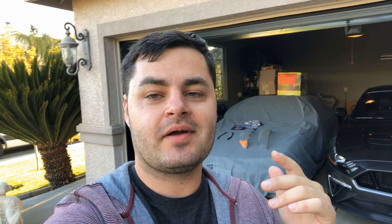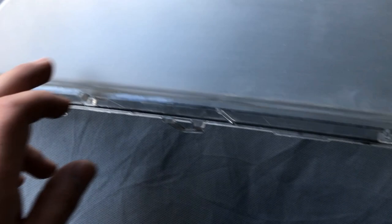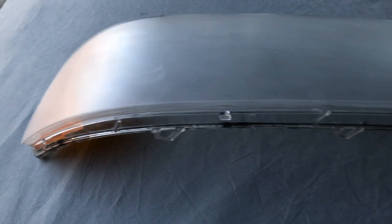Finally done — about an hour and 30 minutes later. Lenses are on my car. Let me show them to you. The process was: started off with 600 grit, then I thought I should go down a bit and went to 400. I would say the process for 400 on this type of job is not worth it — just stick to 600, keep scuffing. Your hands may get tired, but in the long run it will be all worth it. Then the final stage was 1000 grit before getting them clear coated. There are a couple little imperfections, but they're not going to be perfect — hopefully at least 90% back to OEM spec. Maybe once a new pair of lenses is available I'll buy some, but for now the only thing left is to get them to the shop and get them clear coated professionally.